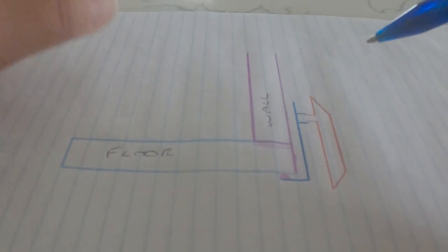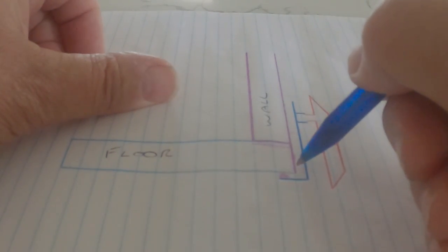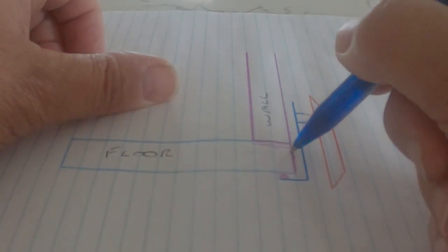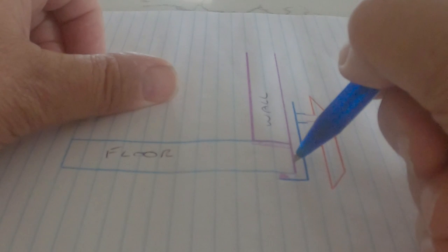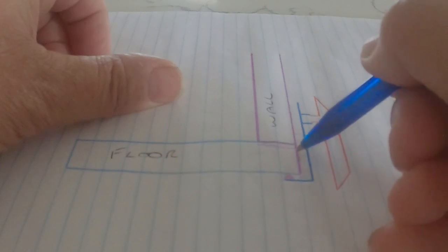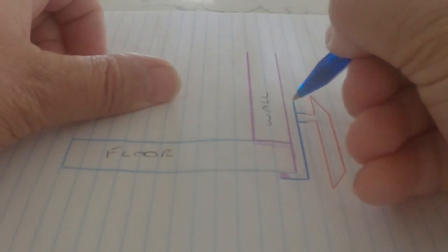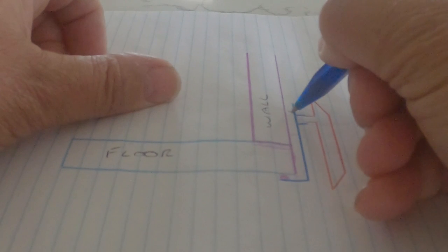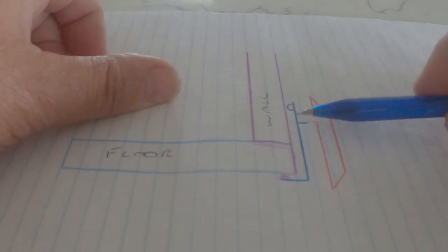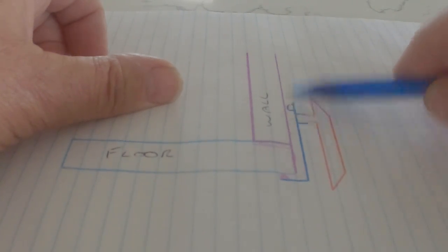Okay, so what I'm going to do to sort out the problem is I'm going to clean this all up, I'm going to reseal, I'm going to dry out any moisture in this section of the wall here, this overlap, reseal it all and restaple it, and then I'm going to also put some sealant over the top of the staples so that no water can soak in there if ever we had a problem. I'm going to run a bead of silicone in here, which once this is attached to the caravan is going to squeeze out the top so that I know that it's perfectly sealed in that section.